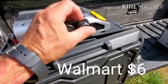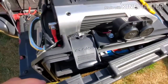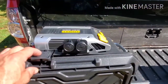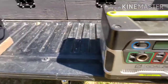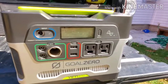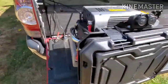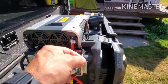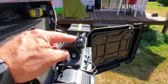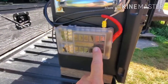I added a dual cigarette lighter — that's just a rubber cover, and these are just screws I had in my garage. So in total: one cigarette lighter, two cigarette lighters; two USB ports, three USB ports; two 110 outlets, two 110 outlets. I was running my fridge off this cigarette lighter plug-in over here, so I had to have it on a 15 amp fuse. I bought this fuse box off Amazon for $15.